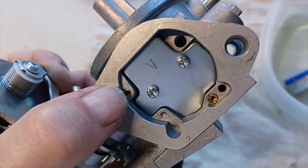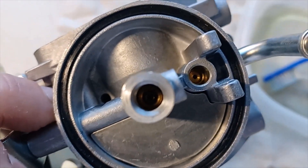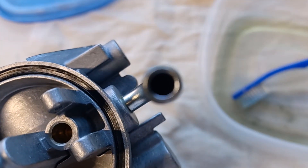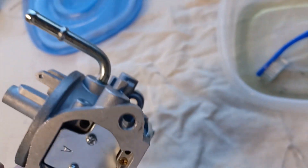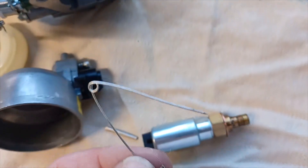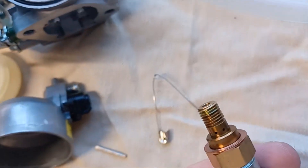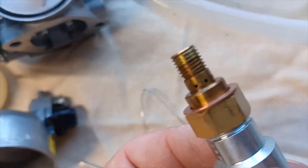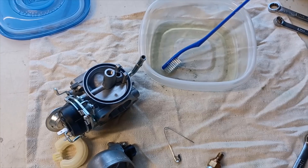This little orifice goes right to the center and runs the brass rod into the main body of the venturi. The other one is the seat where the needle goes in — basically where fuel comes in from the fuel inlet, let in through the needle and seat, and fills up the bowl. I ran air through those to make sure they're clear after brushing them out, and used a safety pin to clear the little orifices. This was the culprit — essentially the main jet — and blowing air through it was sending sand and grit out at me.